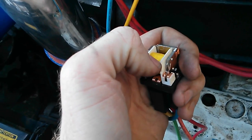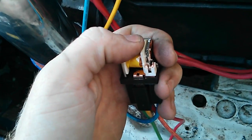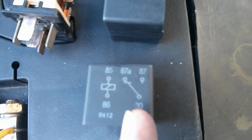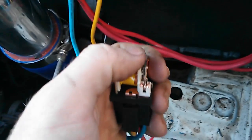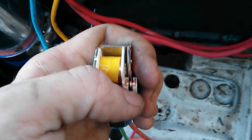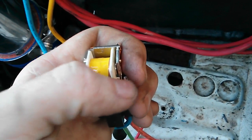I've got this connected in. Pin 30 is going out to my radiator fan. As you can see on this little diagram, pin 30 is always in it — it's always connected. So pin 30 goes out to my radiator fan, 87A is one power source, and 87 is the other power source. Right now 87A is closest to where my finger is, so that power source would have power and the radiator fans would be on if the car is up to that temperature.